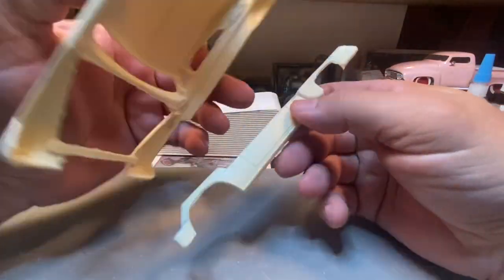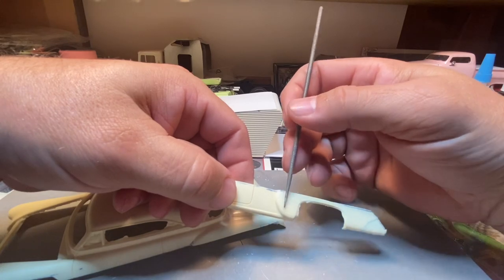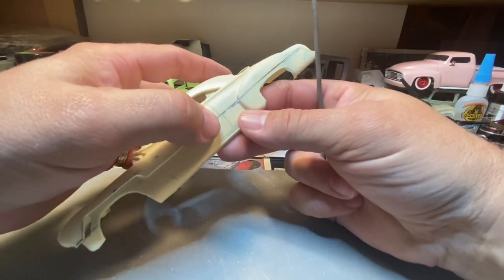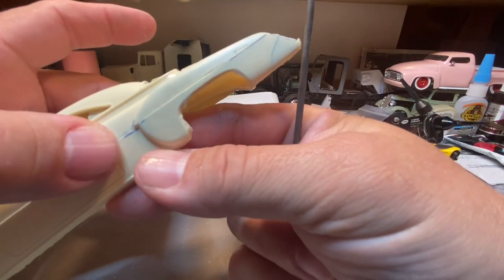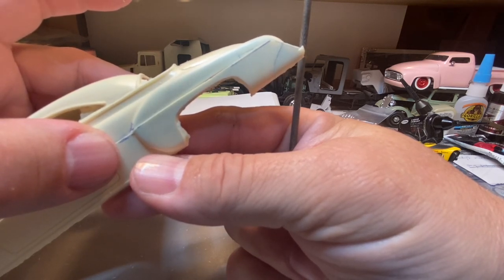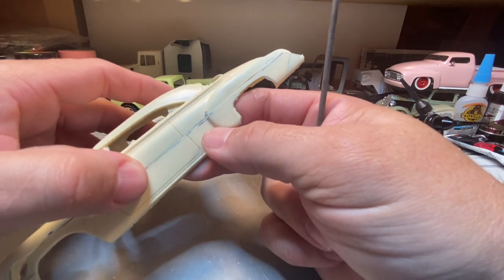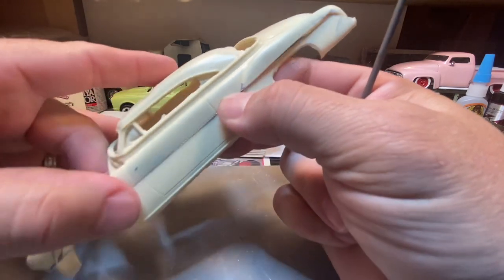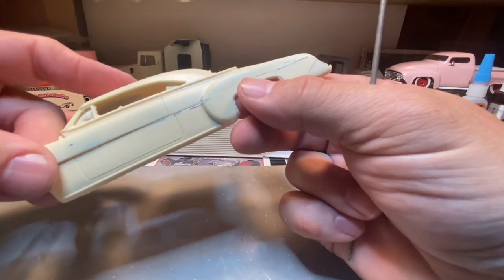Now when you're doing this, this reveal where the fender is — when you put this back together again, you don't want to line that up the way it's sitting there. You don't want to line your fender up and put it back together this way because that's going to throw off your wheelbase and move your wheelbase toward the back of the car. By lining it up off of that you can see where your door lines are. By lining it up by the rear fender, this section right here, it moves your door line back almost an eighth of an inch.